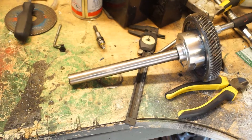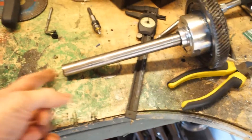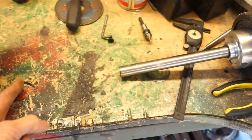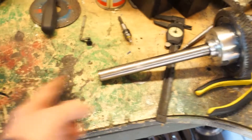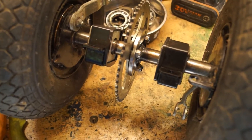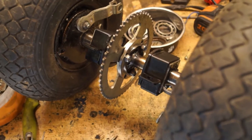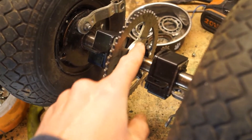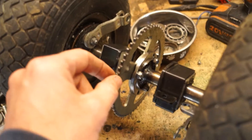I'm only making a short wheelbase, so I measured the half shaft - it was quite long - and I cut it to the same size. The half shaft comes out and I weld it together to make one solid shaft. One of the bearing caps is fitted on; I position that on where the weld was, then drilled and bolted on this sprocket.